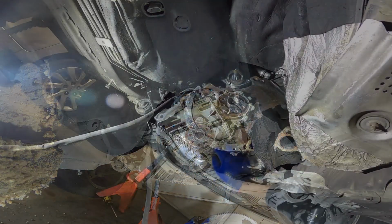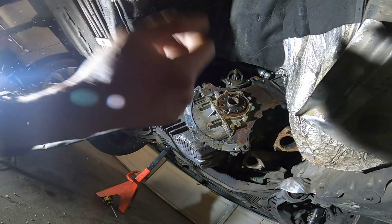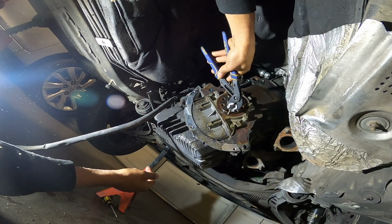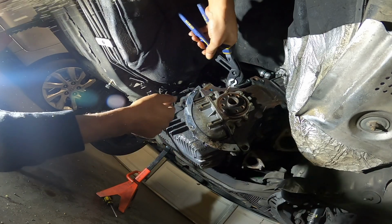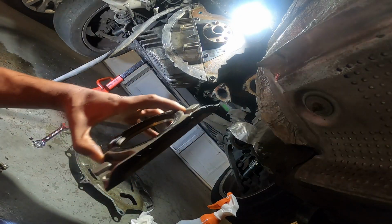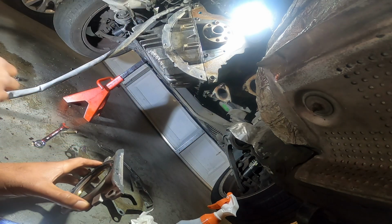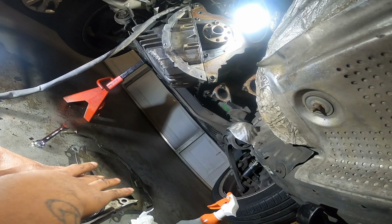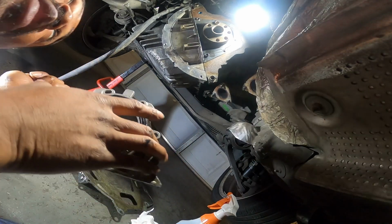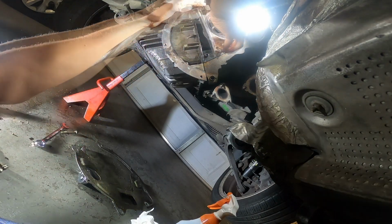And the rear main is leaking. So now we got the rear main seal. What you want to do now is just drill a screw in there, grab it, right? It's supposed to come out. All right, so I got some gasket maker on the bottom of it right there, and I got some on the bottom down there behind the gasket, because once you take this off right here, pretty much the oil pan gasket may not seal like it's supposed to.